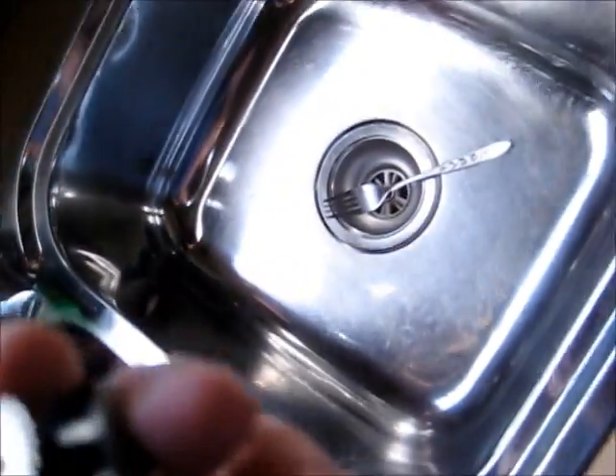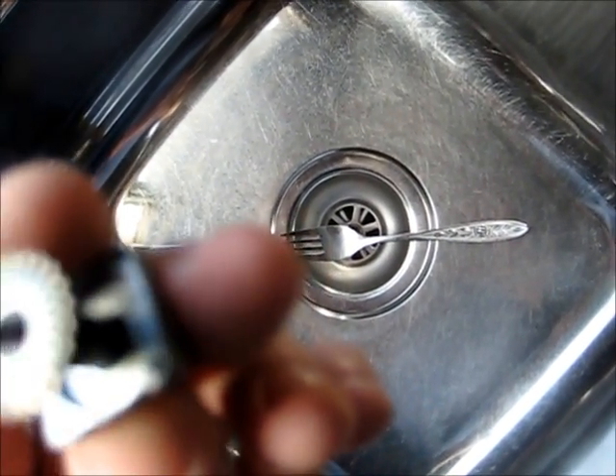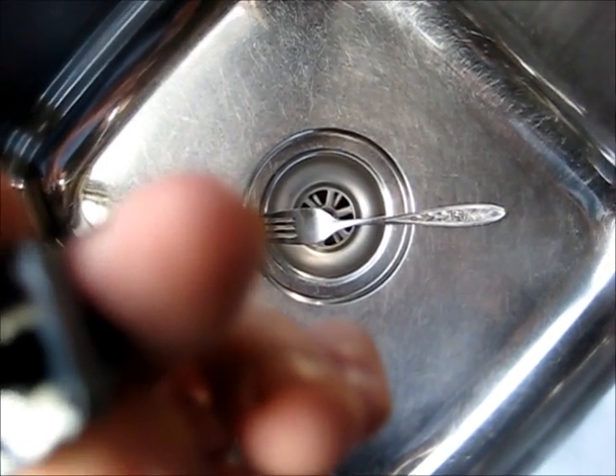That's all it is — little contacts and a top contact which rolls on these. All that does is tell a digital microprocessor inside how loud to control the volume. It's just a digital volume control. If I pull this little thing out and inspect it under some sunlight, I'll probably find it's very fine — just the way it's worn basically. You can see on the outer edge the way it's just worn out. The contacts are not very good. I'll get some contact cleaner on a little cotton bud and just brush those contacts over and polish this up as best I can. Hopefully it should work properly.